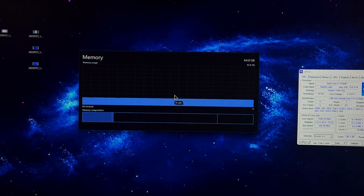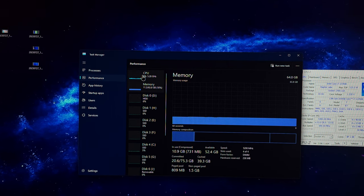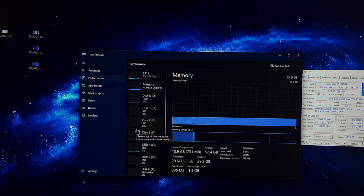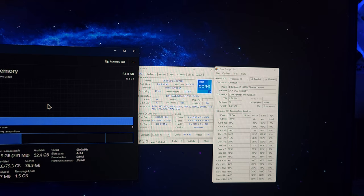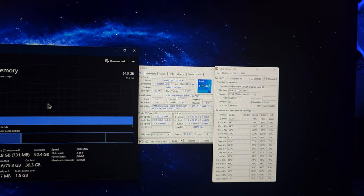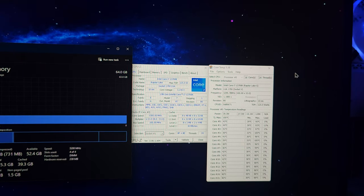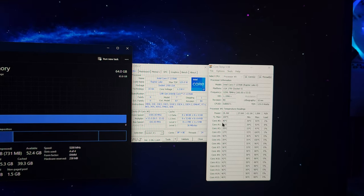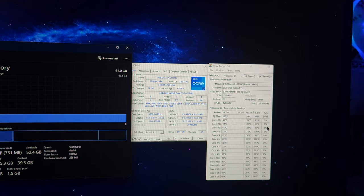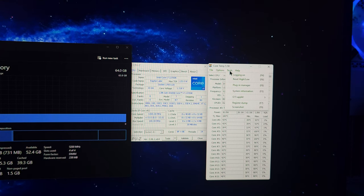And this is crazy. But for those of you who are having issues and you don't have any malware or anything, and you're wondering why your temperature is through the roof, these 13th gen processors run hot like the 12th gen processors run hot. But keep in mind, do all your checks, and if that is still not what's going on, get yourself a contact frame. Matter of fact, if you don't have a problem, get yourself a contact frame, fix the issue. You don't have to worry about bowing. You will get a solid contact to that processor, and the temperatures will be fixed.